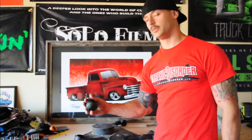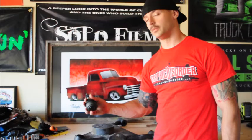Now we've got the lower control arm out, got our new ball joint in — get this over to the shop, get the old one pressed out, the new one pressed in, get that truck done, and focus back on Malaika.